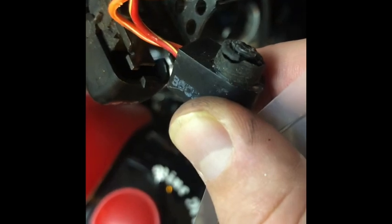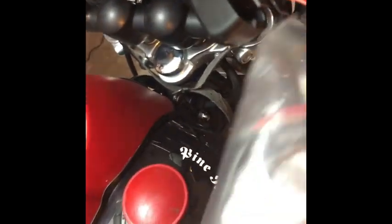I have a new switch. As you can see, if you look at the little nipple on the end of that switch, you can see where it's broken off there — and that's why I'm not getting contact. So it's pretty straightforward from here. All I've got to do is cut this wiring and solder in the new one.